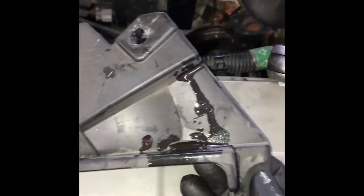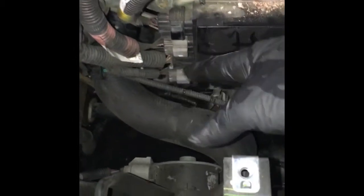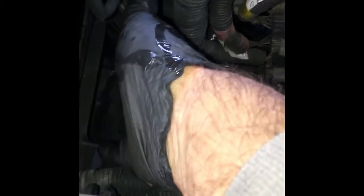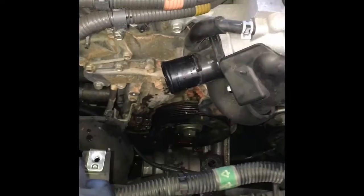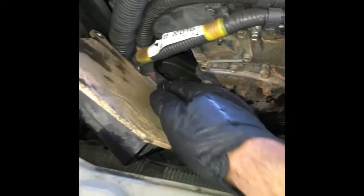Remove this plastic cover, removing those plastic nuts. We're going to remove the 10 millimeters here, here — and there's a hidden one under here, go ahead and remove that — and this whole PCM and bracket assembly will come out. Just leave everything hooked up and kind of push everything to the side. Now that the PCM is unbolted, push it over to the side; don't unplug anything.